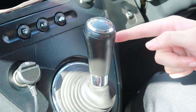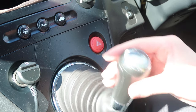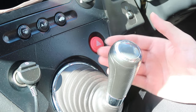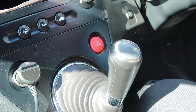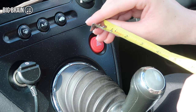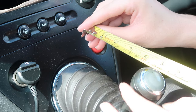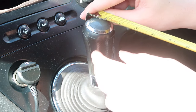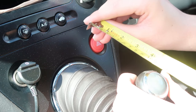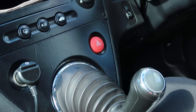The first thing I'm going to do is measure from third gear to fourth gear, measuring at the top of the gear stick so we get an accurate and fair measurement. From third into fourth we need to move it down a bit - it's about 10.5 to 11 centimeters.